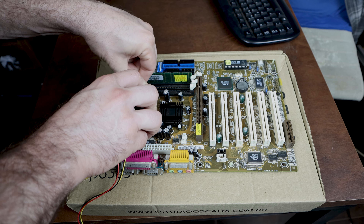This motherboard didn't come with an IO shield, but back then this layout was sort of a standard. Comparing it to another motherboard you can see the IO ports are in exactly the same spot. The TUV4X swapped the serial port for an onboard VGA port but kept the same layout, and I do have an IO shield that fits.